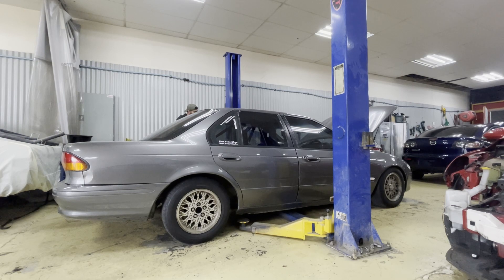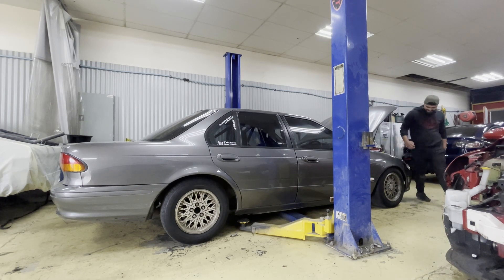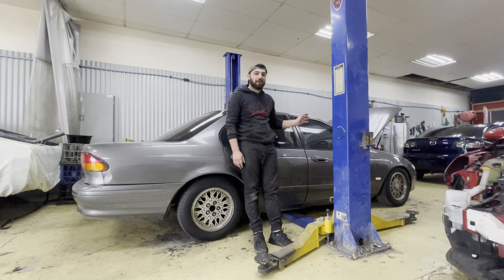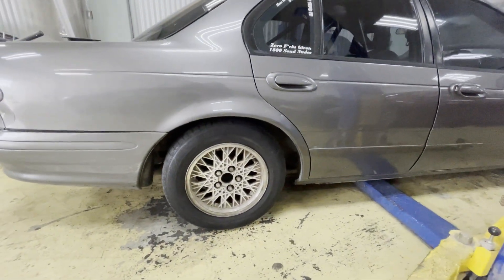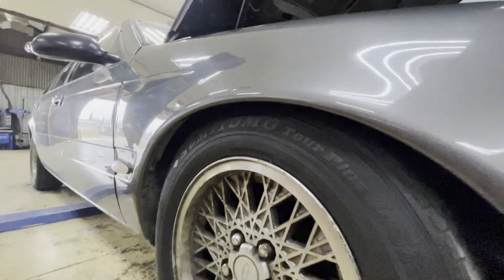Oh no! It's still on the hoist. Alright, so I think the back can come down a bit more. The front — I think I've done too much. I'm definitely going to have clearance issues with the guards on the tyres. But I must say, it looks spicy. The back can definitely come down more. The front, we're definitely going to have some clearance issues. This side here is actually not too bad, but this other side — it's already lipped the guard from before. So I'll definitely have to roll that guard. I'll take it outside and have a look and see what I think.